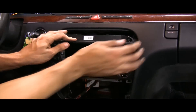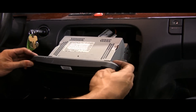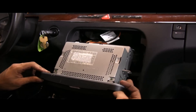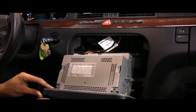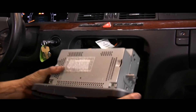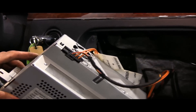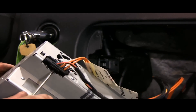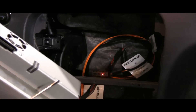Once you do so, just pull it out — be careful not to crack the screen. You'll notice on the later models they use fiber optic connectors, just one connector called the MOST system. I use my pocket screwdriver to push it in, and you see a little bit of light showing — that's your fiber optics for your radio, the system Mercedes uses.